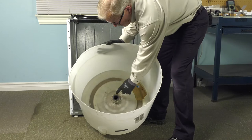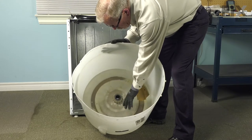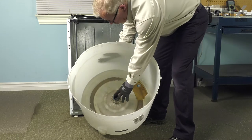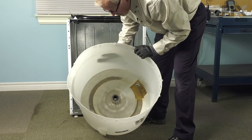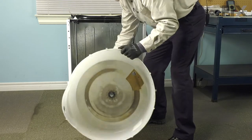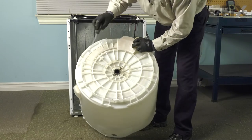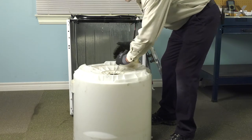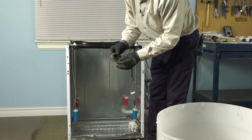Now, our last step will be to remove the tub seal if it's in good condition. Inspect it carefully, and if there's any signs of tears on that upper lip on that seal, you should just discard it, or if there's any signs that the seal has been leaking and there was water on top of the tube and shaft assembly, again you should replace it. Normally they're in there fairly snug. To remove them, you will need to put a screwdriver in underneath the edge and pry up on it — that normally causes some damage to the seal, so you're better off just replacing it anyway. Just take your large flat blade screwdriver and go in from the bottom through the tub bearing at a fairly steep angle and give that a bump. Now, with the seal removed, we'll have a good look at it and there is some tearing on it, so that will need to be replaced.